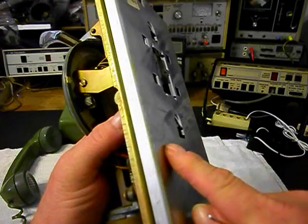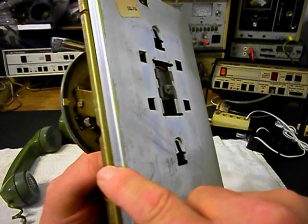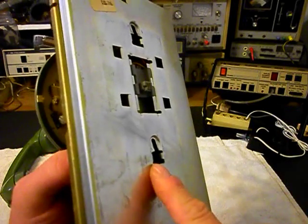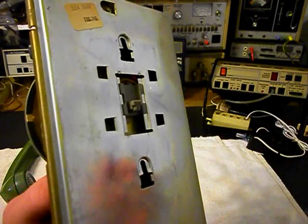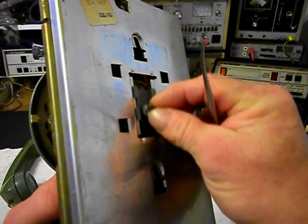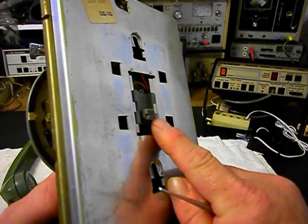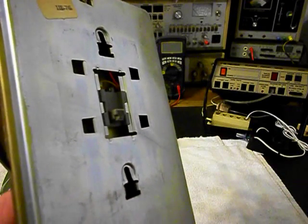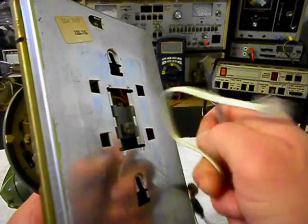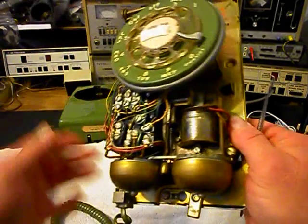This plate was installed so that this telephone would hang on a wall. Normally this telephone would just be bolted to the wall. But since they've added this plate, we're going to go ahead and keep the plate. But this is going to be changed here — the modular port adapter that plugs into the older style wall jack. That's going to be changed, and we're going to have a piece of line cord that comes out and can be tucked back into the telephone once hung on the wall.